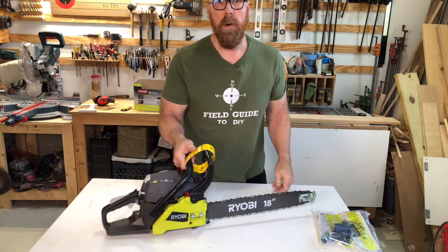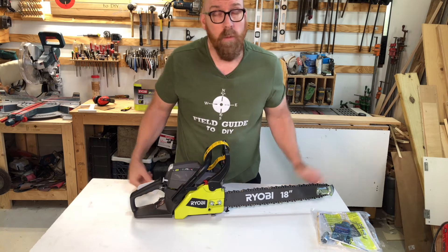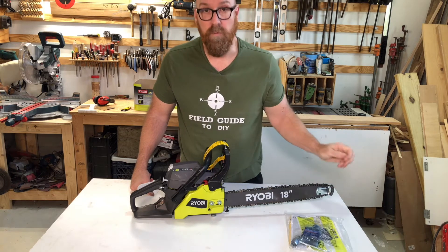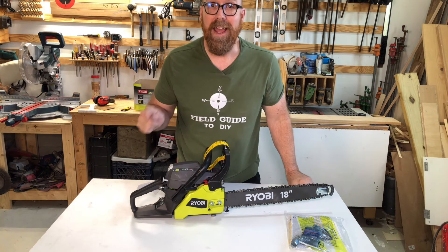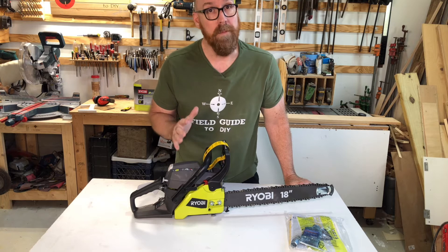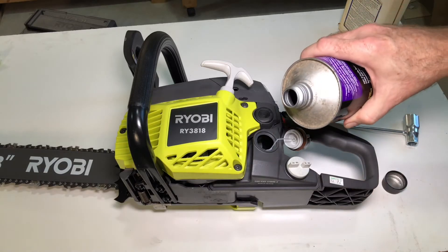However, this is a small engine, and if you go to your local gas station, that fuel is going to have ethanol in it. I've had numerous small engines repaired and finally asked why I kept going through them. The repair guy asked if I was running regular gasoline — I said yes, doing the 50 to 1 or 40 to 1 mixture. He said that's the problem. Ethanol runs hotter, which is okay for cars, but for small engines like weed eaters and chainsaws, it tends to warp the head or set the cylinder out of round — which was exactly the problem I had.